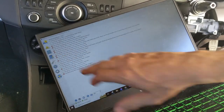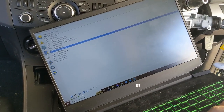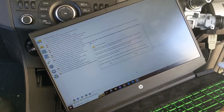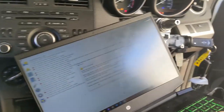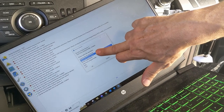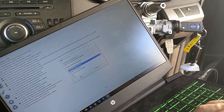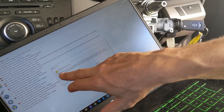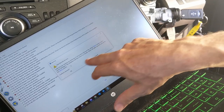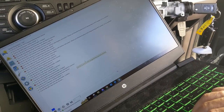So what we're going to do is go down to the spanner icon, go to Service Procedures, and go to PATs Programming. Once we're in PATs Programming I'm going to press the play button, and it gives you a warning about adding keys and so on. You'll notice the second option is 'Erase and Program Keys' — that's the option we're going to use today. I've got the key in the On position in the ignition, I click OK, and it says: 'Coded access requires exchange of information between the vehicle's PAT system and a central database. The database will return an in-code which will allow security access to the PATs.' You're going to say yes.